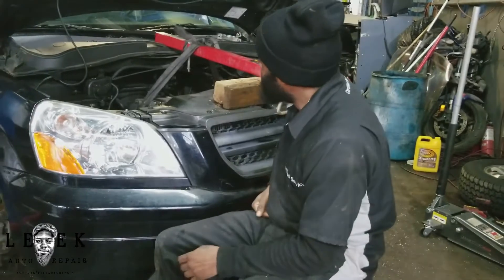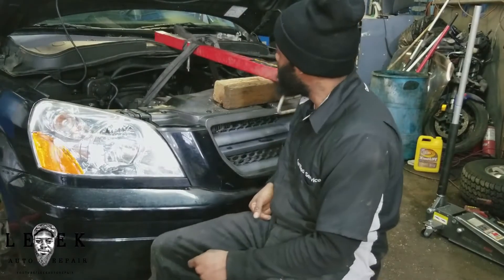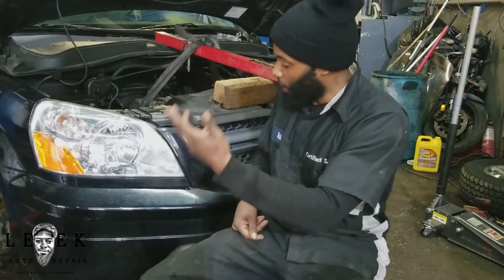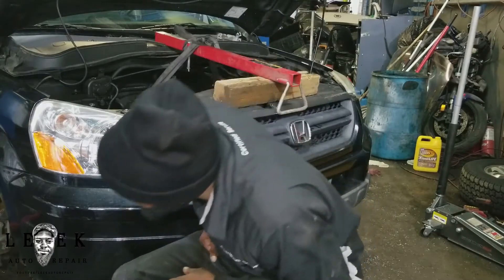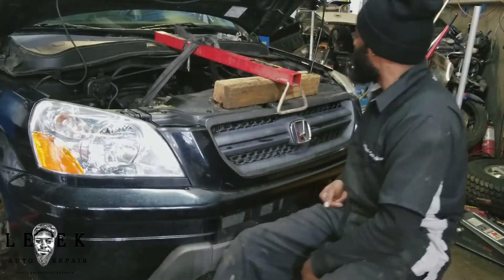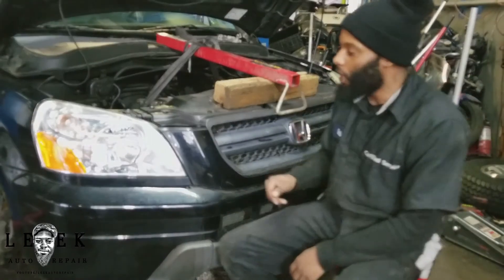As you can see, I did a little cut and edit. Like I said, it wasn't that bad. It's like climbing a mountain to get your subframe out — once you get the subframe out, you got the engine lowered down some, got enough room, get the transmission out. I left the suspension on with most of the parts. Left the rack, got the steering wheel locked into place, got the rack still on the subframe.